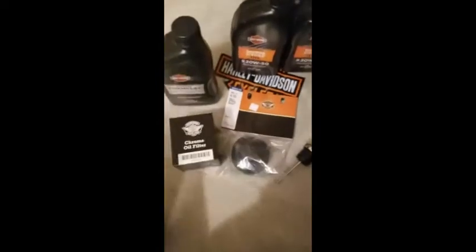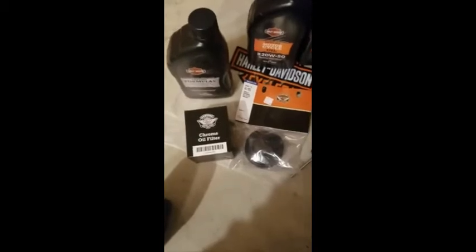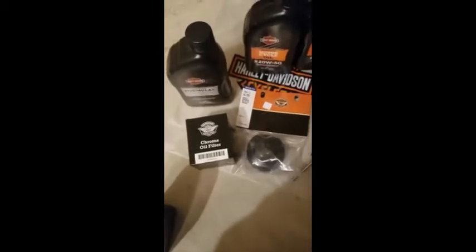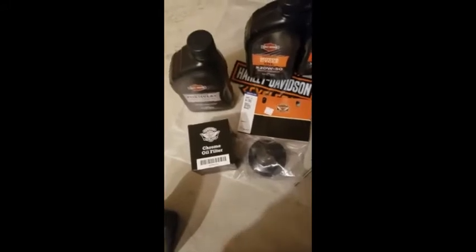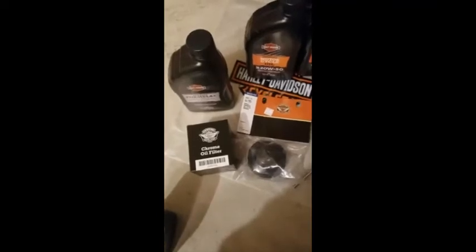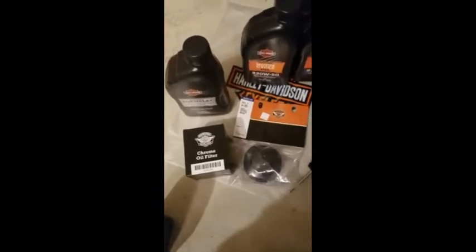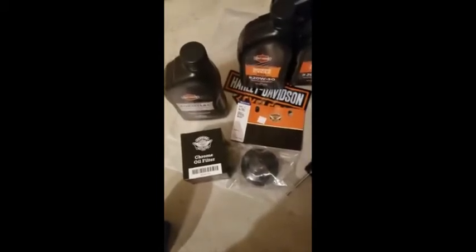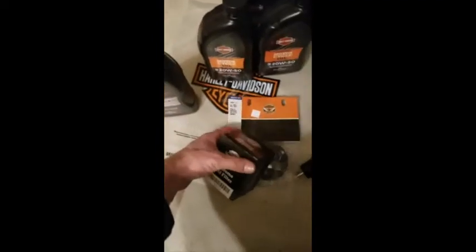Next up is to change the oil filter. I went ahead and bought the right oil filter for a 1994 Harley-Davidson Fatboy Softail, and I also purchased the oil filter tightener wrench to remove and install the oil filter cap. The important thing to remember: once you remove the old filter and put the new one on, put about four ounces of oil in it, put some oil around the seal, tighten it to hand-tight where the seal meets the casing, and then use your wrench to turn it about three-quarters of a turn to snug it up. Don't over-tighten it.